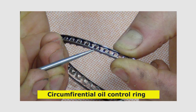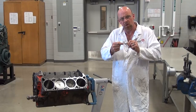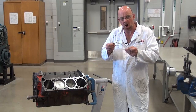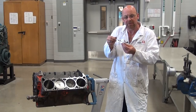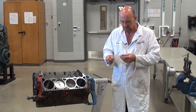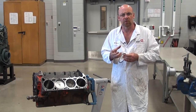Some are spiral wound, this one is cut — it almost looks like a digital sine wave — and it's a way of holding engine oil in all these little voids. When we hold the engine oil in there, it can be controlled going on and off the cylinder wall by the movement of the scraper rings as the piston moves from top dead centre to bottom dead centre. Piston rings do a lot of work for us in the cylinder.